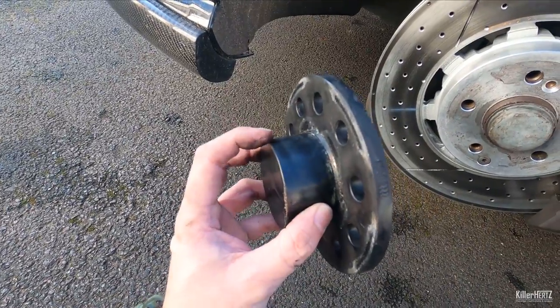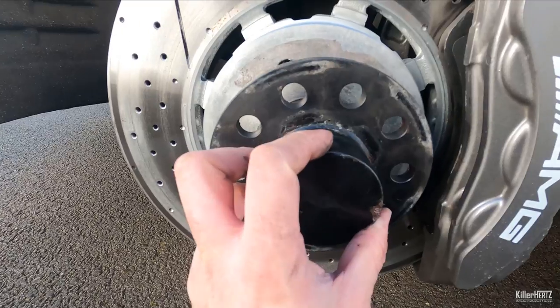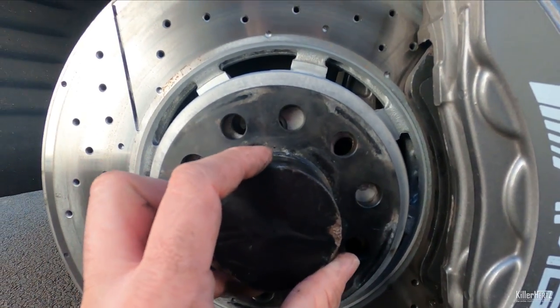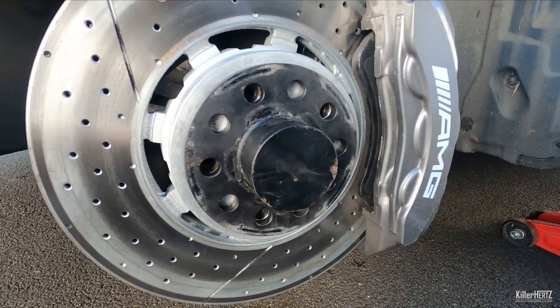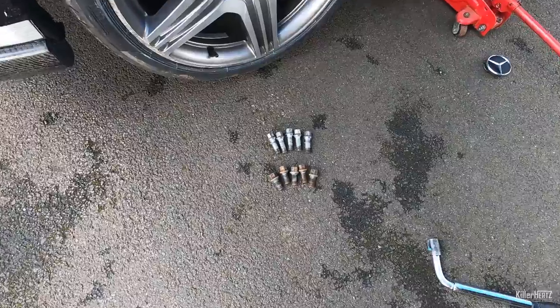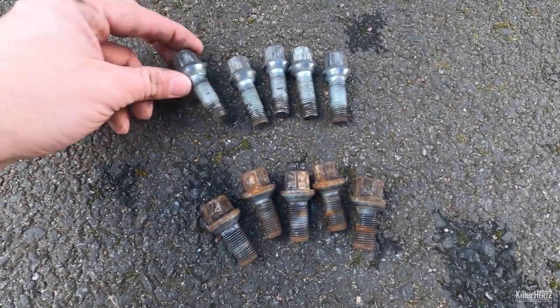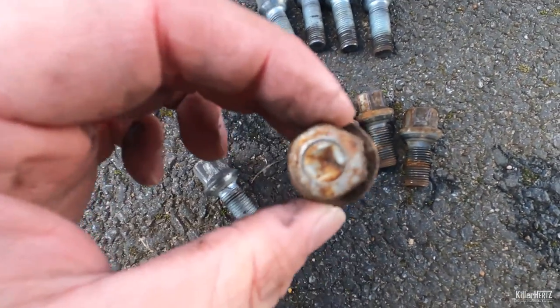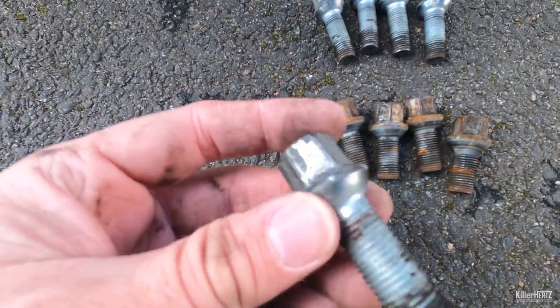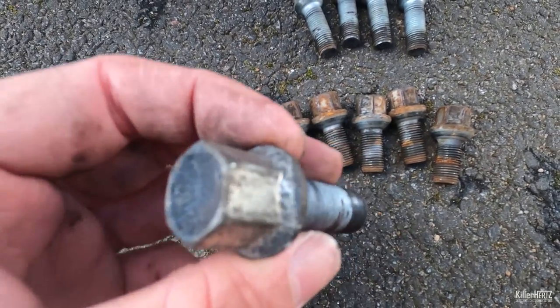If you're not aware of the difference between hub centric and non hub centric — hub centric in a nutshell are designed to carry the weight of the wheel on the hub rather than on the bolts, which is safer. With it sitting in place you can clearly see here where the wheel will mount onto, with the central tube for the wheel to slot into. With any spacer setup you also need to buy the corresponding bolts to go with them. H&R also include the 1cm longer bolts within the kit. Note that the original Mercedes bolts are the rusty ones. It's vitally important that you don't cut any corners and buy cheap bolts — cheap bolts generally have really soft or weak metal and are prone to snapping or threading themselves within the hub assembly.